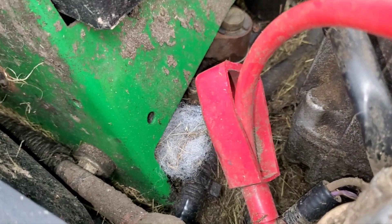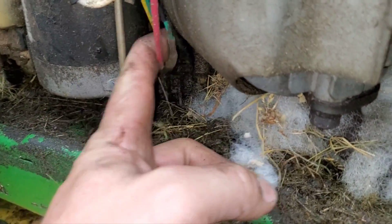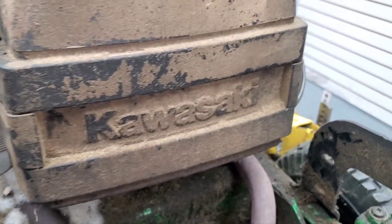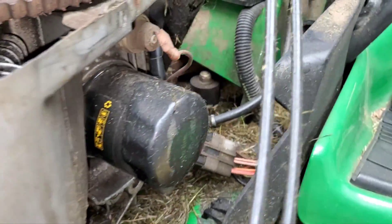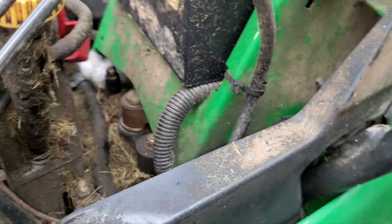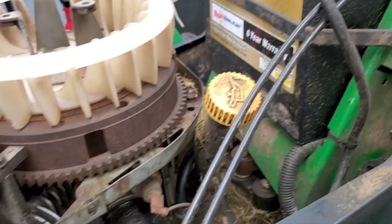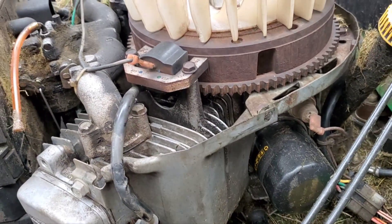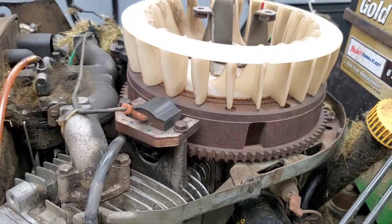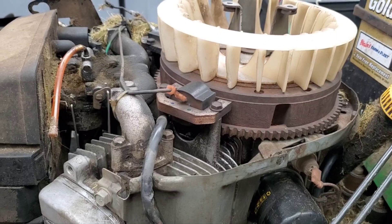You can see they've been using this place as a home, so they've probably been in and out of this unit pretty well everywhere. Take a look at all the wiring extensively — just everywhere there's wiring. Those mice have been up in here for a pretty good long time, probably during the winter, but it could be something more current. On any other mower, same thing — just take a look at the wiring regardless of brand, make, or model. If you're getting it bogging down like that, you could very well be running on one cylinder. A lot of times people bring it in thinking they're having a carburetor issue, and it ends up being one of the cylinders isn't running — whether it be a coil, a valve, a push rod. This is one of the most common ones: vermin.